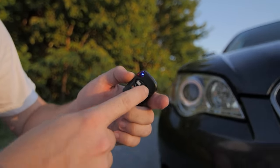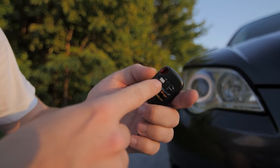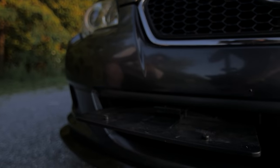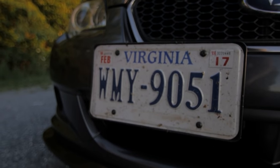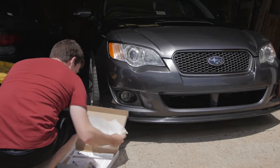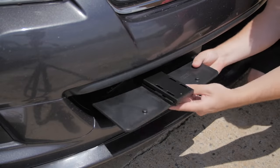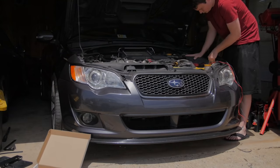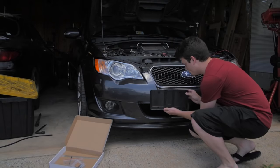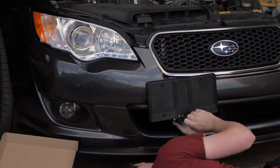They give you these remotes — one for folding out and one for folding in. When I hit the folding-in button I just hold it down and it folds in; I press the folding-out button and it holds out. The installation was pretty straightforward. They gave me a box with a bunch of papers — throw those aside — and you'll find the bracket. It's all one piece and bolts up pretty easily. You'll need to wire in the power and remote receiver on the battery, then fold it out and line it up on the bumper where you want to put it, then drill two pilot holes and bolt it up.